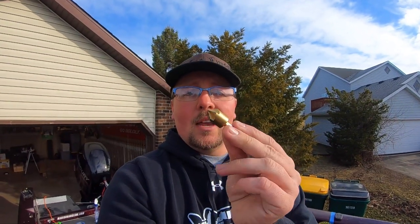The redneck way of doing this — especially with smaller screws — is to use a Phillips head driver bit on your drill at high speed and use that to ream out the gel coat around the hole. It works very well for small holes and small screws if you don't have a chamfer bit. But again, I would highly recommend you pick up a set — they're very cheap and I'll have them linked in the description below.